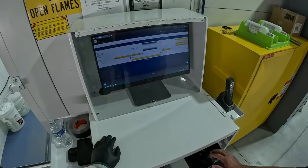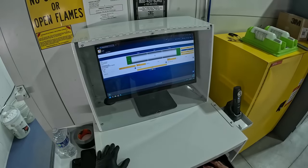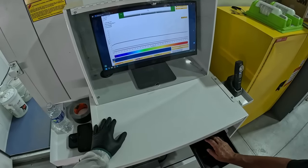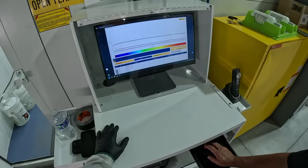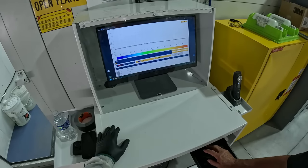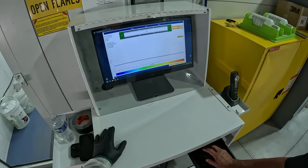So remember, guys, with this line, there's no chip. So you will be using the camera on everything. You've got to get very familiar with it and get it dialed in. We're going to hit details here. We're going to pull up five different formulas and look at this spectral curve. Our target is what the camera saw. On the left side is our match. That's a real color in our data from BASF. And the green line is our adjusted line, what the software saw and adjusted.